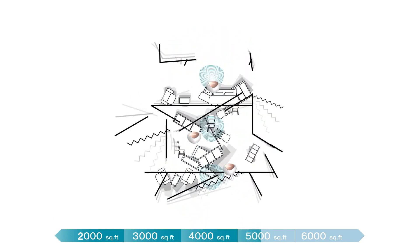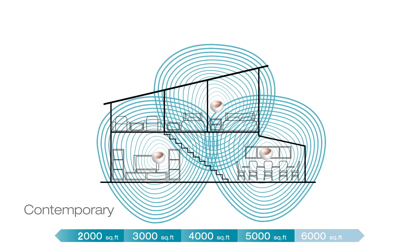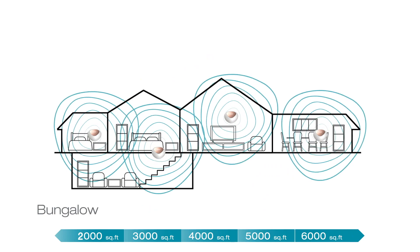It's a dual band system, supporting both a 2.4 gigahertz connection and a 5 gigahertz one. 2.4 gigahertz is supported by more devices and gives you broader range, but there can be interference from other 2.4 gigahertz devices like baby monitors, microwave ovens, and cordless phones. 5 gigahertz offers greater speed and less interference, but you do have to be a little closer to the points or the router.